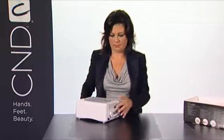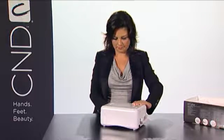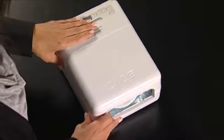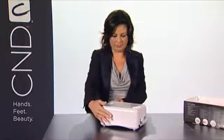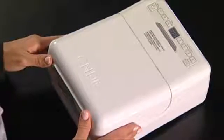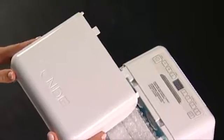Place the lamp with one side facing you, holding it firmly with one hand, with the other hand on the removable cover. Place one or two fingers inside. Firmly pull on the cover forward and slightly towards you until it pops free. Now face the lamp opening towards you and pull the cover off. To prevent the locking tabs from breaking, take care not to put excess stress on them.